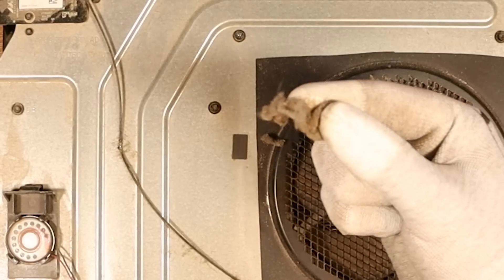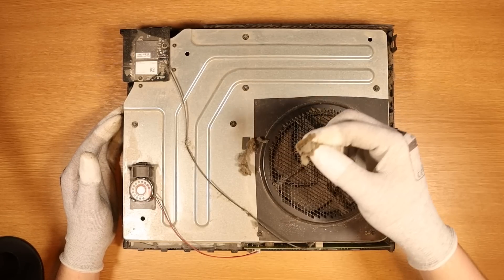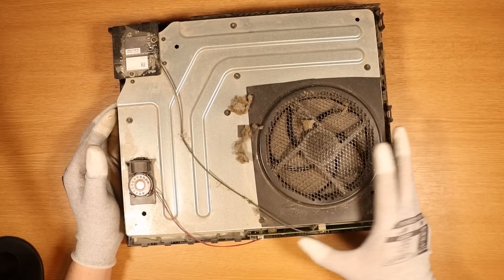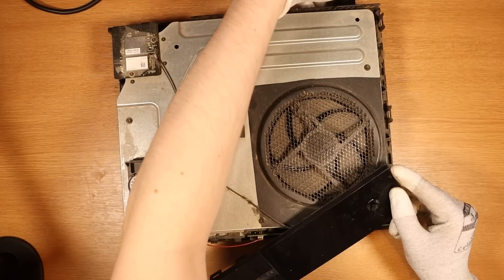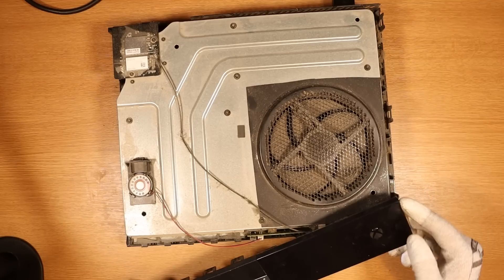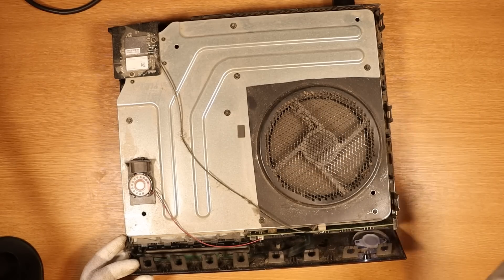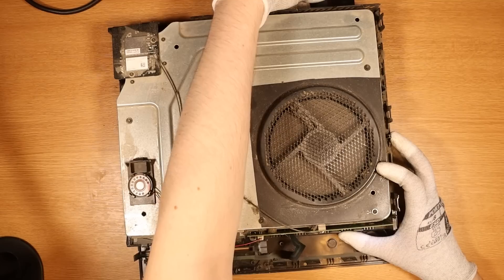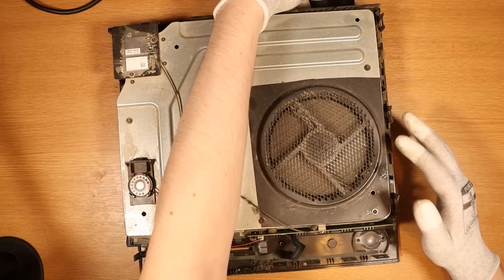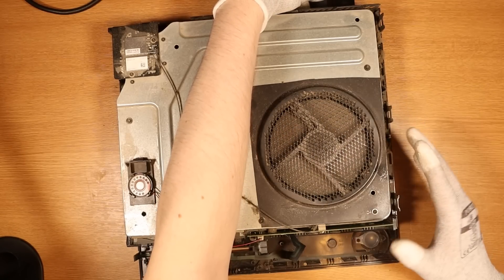Other than being just ridiculously dusty, the front ribbon cable wasn't actually connected to the panel to be able to turn the console on. I'm going to get rid of some of this dust and put the power cable in to test it. With that now plugged in, let's see if it powers on. It does, and we also get the LED at the front. However, after a good couple of minutes the machine's been on, we still don't get any display. Let's start with a simple fix of just changing the hard drive and see if that makes a difference.